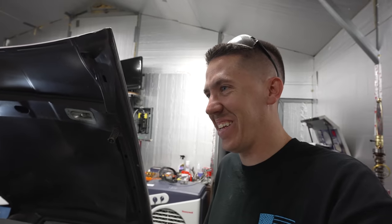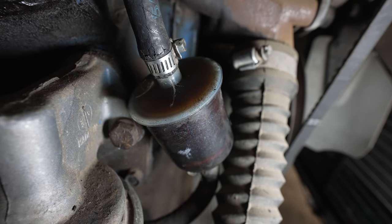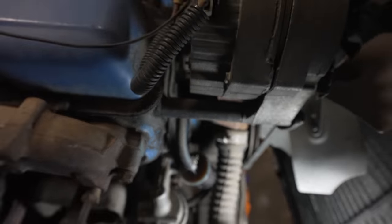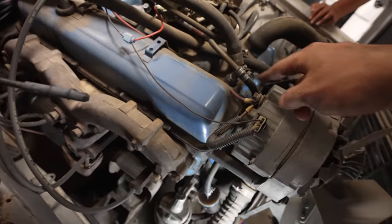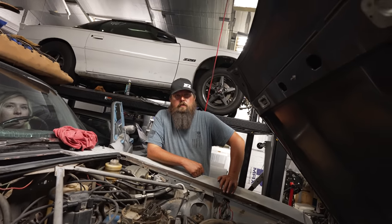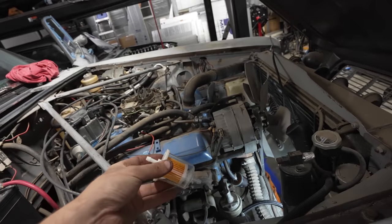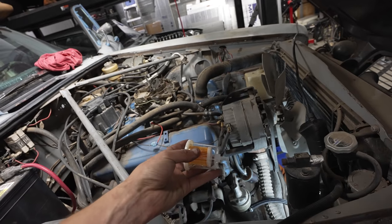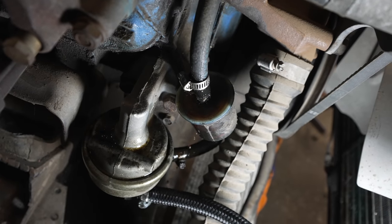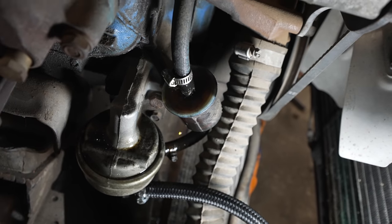Looking at the fuel filter - it looks pretty gross, like reddish and all kind of dirty. I might just pop the line off and put a new filter on it. That would be the only thing I could definitively see - that fuel filter being pretty gunked up, especially with how gross that fuel was. Good thing we have a spare fuel filter from old Kleenske for race week. We might just stab this one on there and then at least we know we got a new fuel filter. That reddish color is gross - I don't think we're getting any fresh fuel through there quite yet. We'll try to get that popped off, put in a new fuel filter, and hopefully get some fresh fuel up to the carb.